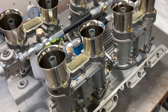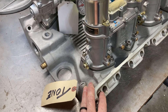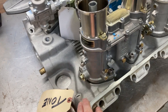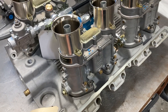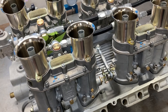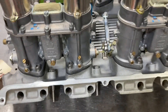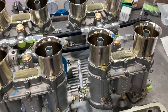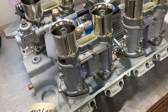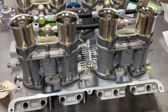Today, though, I'm going to check port alignment and see how well the geometry fits. The cylinder heads — very rarely do I get to bolt an intake on without adjusting it in some way, and that's not only FE specific but all-engine specific. First thing that has to happen is these bolts are pretty much capped the way that they are, so these carburetors have to come off. I want to get everything off the manifold and then we can put it on Mr. Dennis's long block and see what it looks like.